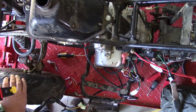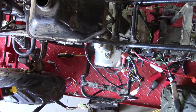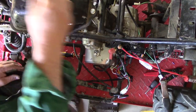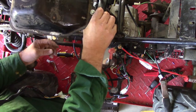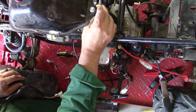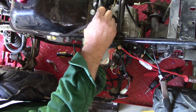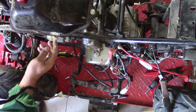Let's put some gas in it — I bet the carburetor isn't going to just go. Let's jack up the back wheels first so it doesn't take off. We've got to raise this tank up because it comes out the front here. When that bracket is broken, the tank tips back and all the gas goes to the rear. We need it like this so the gas drains out the front. It could actually be a little higher than they had it.